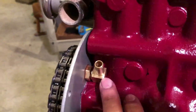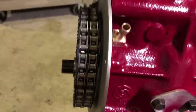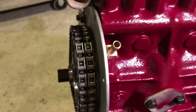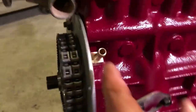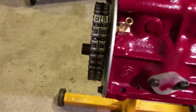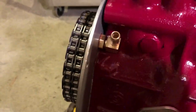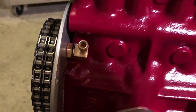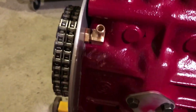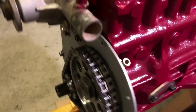I've thought about this for many years. A lot of times you're worried about having something on the inside that could come loose and fall into the gears — a disaster depending on the type. I made sure this one would clear, but when I tapped it I saw it had a really good grip, so I elected to do the jam nut on the outside. No chance of anything falling in — if you notice it's loose, you have an opportunity to tighten it up.